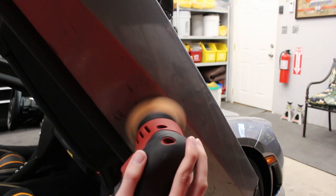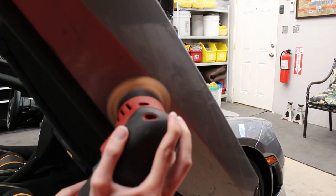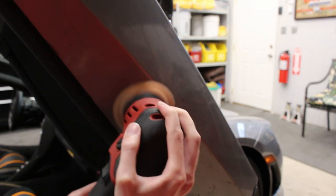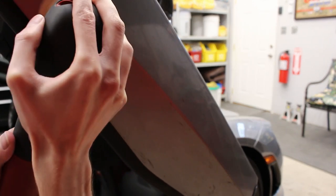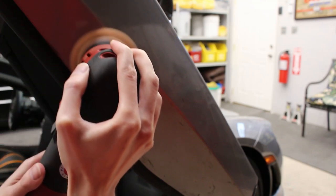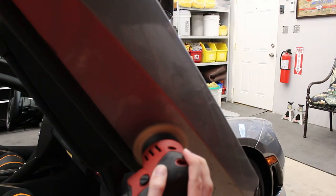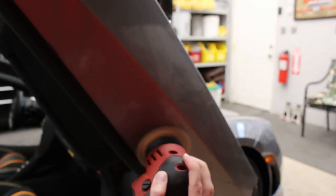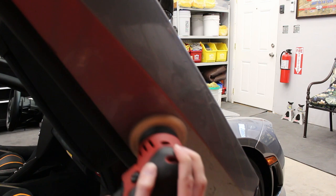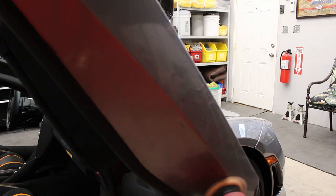And there's no way that you can clay bar that off and fix it, and there's no way you can do any of that stuff. So you wash it to the best of your ability, and then you follow it up with a polish. And the abrasive nature of the polish will even out. First of all, it pulls all the dirt and all the rubber and everything off, which is step one. And then within that step, you just go back and add more polish, and then you refine it. Basically that step smooths the film out, because the film actually starts to get destroyed.